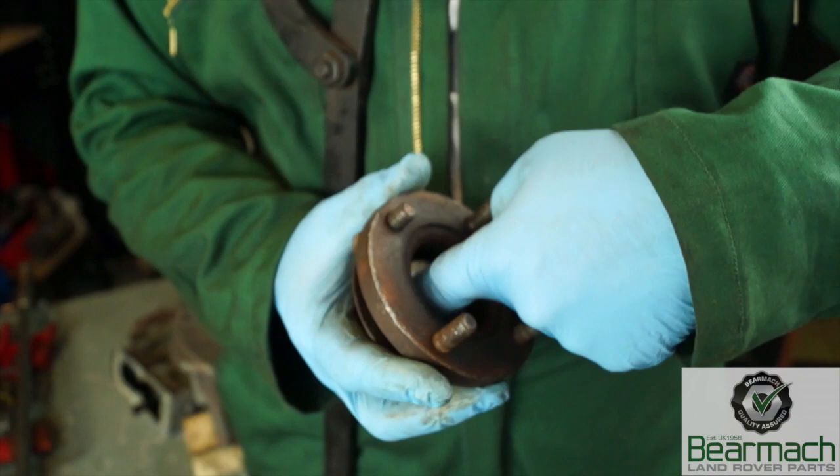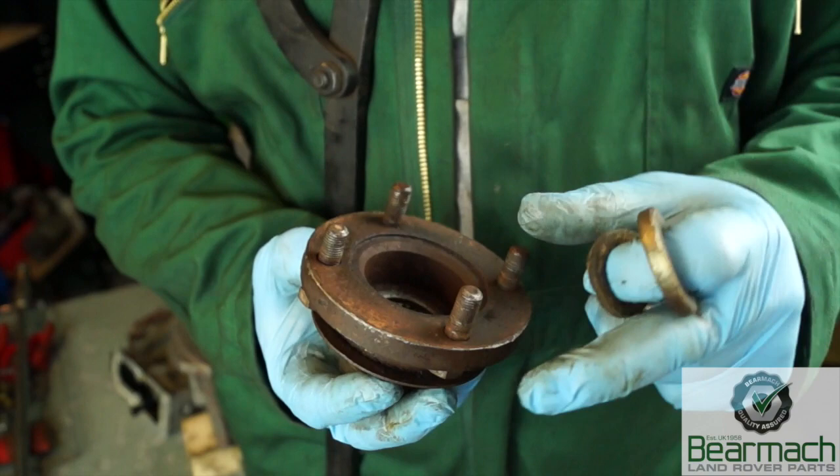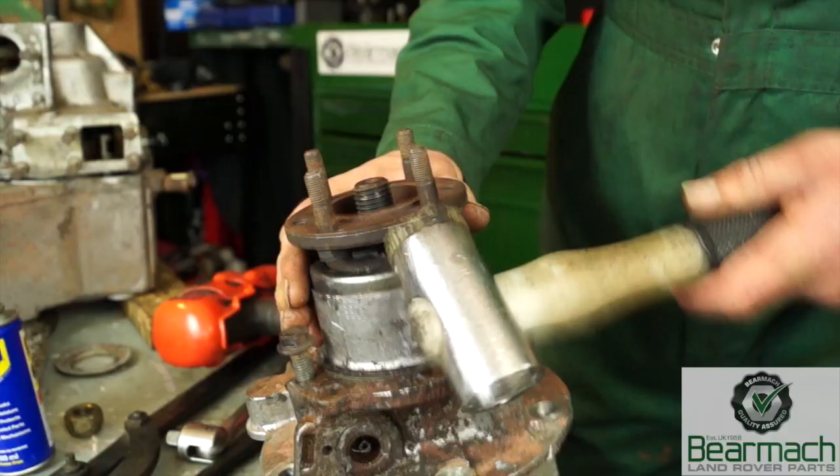In the flange you'll find that you have a felt washer which is dropped through, and you have a washer on top of it and a nylock nut. This is the front flange of the transfer box — it is different from the rear. What we're looking at here is it has a mud shield which will stop the studs from coming out. Good idea to check to make sure that it's not badly worn; if it is, it needs replacing.